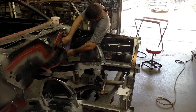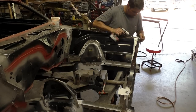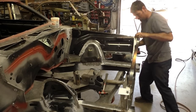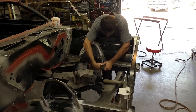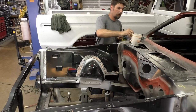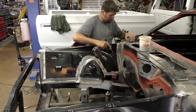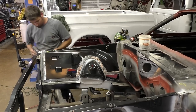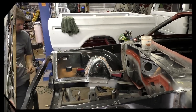Moving on to the inner fenders - same process. Everything for the most part has screw holes in it, so I'm putting in the screws where the holes are for a good reference point. When you screw it in, you're not going to drive it down the road, but I put enough screws that nothing's going to move. If you're assembling this stuff and find that two or three screws in the process don't fit when you pull the whole assembly apart, you need to stop what you're doing and start backtracking and thinking - something's not going together right and you can't confidently weld it.